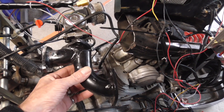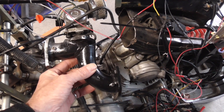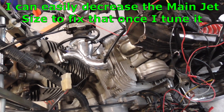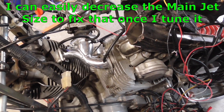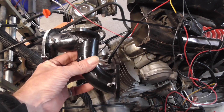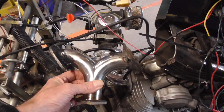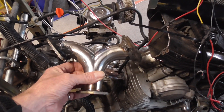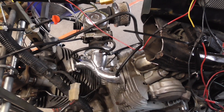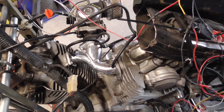I tried this other one I had — it was really unequal on the runners and it did okay, but it was still leaning out especially when I throttled up. Now the good thing about this one is that when I throttle up it actually goes rich, so it's just lean at idle and richens on up. This one here leaned out when you throttled up. Then we had the one that I made with equal runners and it didn't work at all — the front cylinder was so lean you couldn't do anything. But at least this one here gets it close enough. I'll set the camera down and fire it up and show you what's going on.